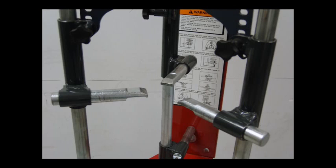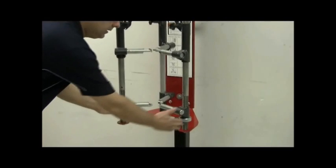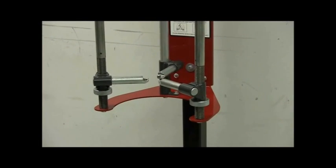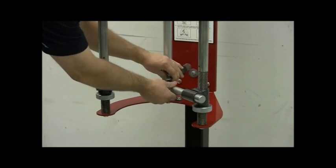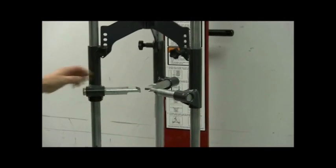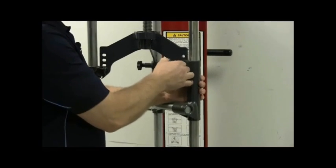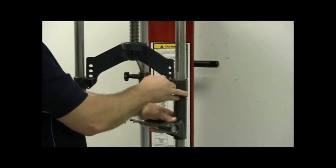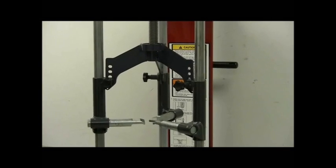The tool is made up of a set of upper hooks and a set of lower hooks. The lower hooks — left and right — are each independently adjustable to match the helix of the coil, while the back one is stationary. They all slide in and out with a bit of rotation. The upper hooks are also each independently adjustable, with four positions on the compression head, adjusted to the angle of the spring seat or upper coil of the spring.